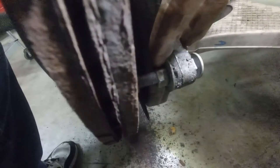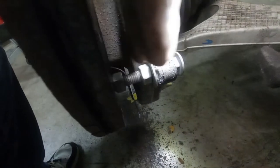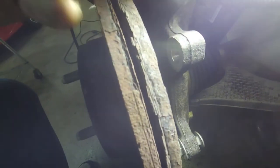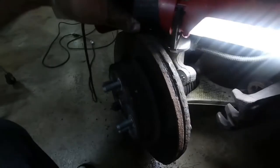What you do is you drive this nut, and as you drive the nut it will suck the bolt in. And with the nut here, just for more surface area, it will push the rotor. Now it's optimal to have two of those and you tighten the top a little, tighten the bottom a little. I lost the other bolt long ago, but I was able to do it with just one. I started at the top and brought it forward, and you can see the rotor starting to cock a little bit, but it didn't come off — put it on the bottom, kept driving it. And then you'll hear a loud pop, and when that happens the rotor is free.